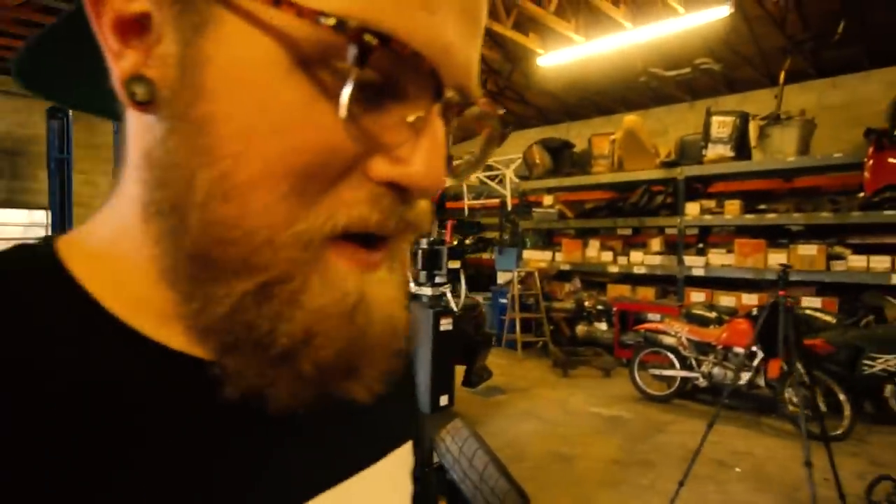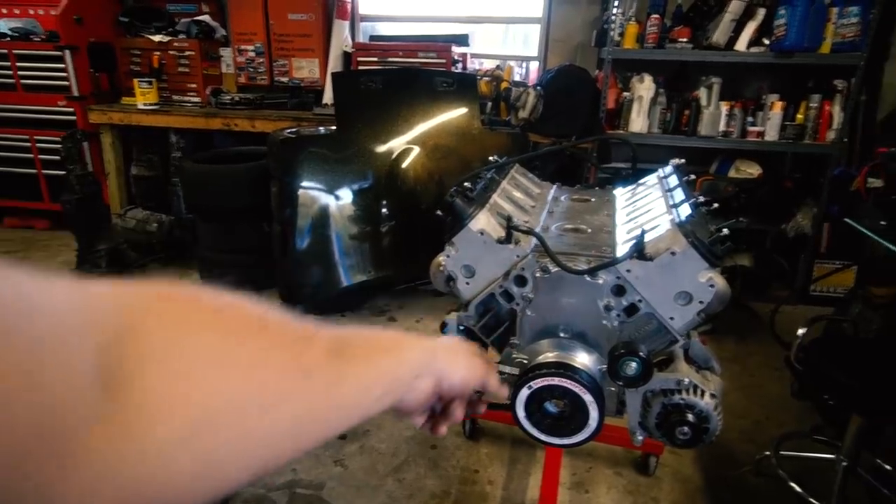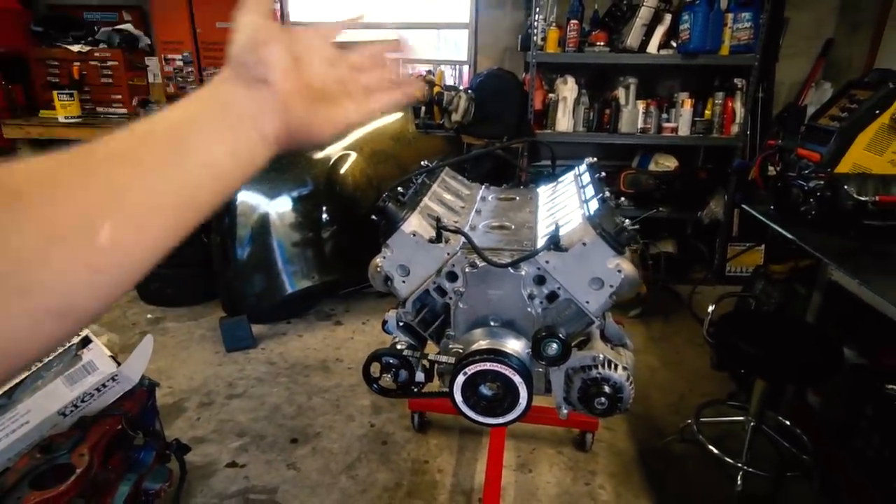Hopefully tomorrow we'll hear back and can get the correct damper by Tuesday. Maybe we can still have it running by the end of the weekend — that's my optimistic goal assuming nothing else goes wrong. I can't put the pan on yet because when I change the damper I'll need to loosen the front cover again to center it correctly, and you RTV the gap between the front cover and the block. So for now we're stuck, but it gives me a nice opportunity to fly the drone and do some emails and order parts. We'll end this out with some drone shots — thanks for watching, thanks for subscribing, see you tomorrow, wish me luck!